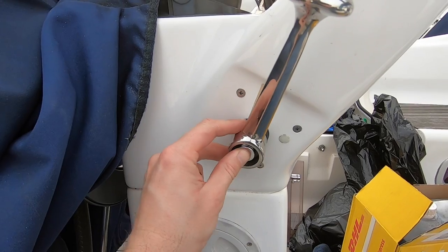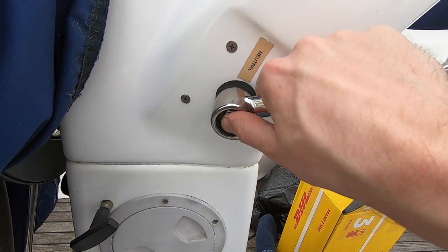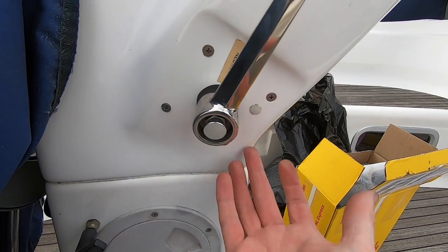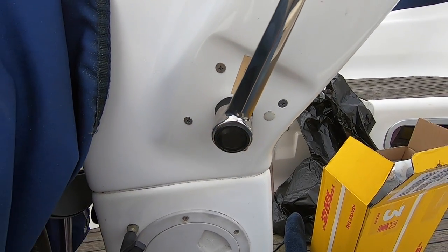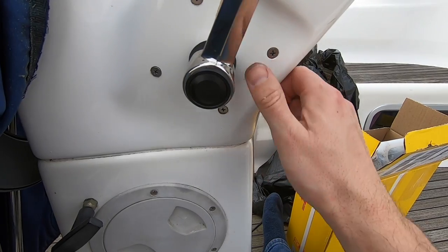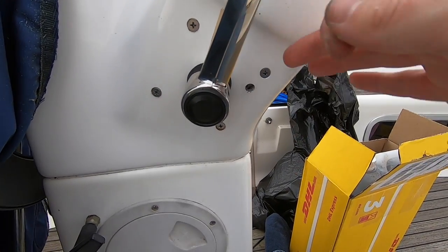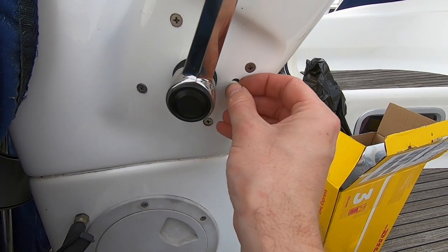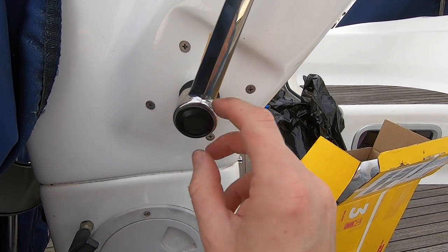This also wasn't working very well, but now that everything's lined back up, when you press that in it's actually popping back out — so it's sitting back in the right place. I've sat and cleaned up the old one and I'm just going to apply the glue and pop that back in — another job off the list. This is the adjuster: behind this little cap here, if you take that off, that's the adjuster. If you need to put more friction on when the lever feels very loose in gear, that's where the adjustment is. You can take this unit out but I don't think it's serviceable. It's now 10 times better than what it was — it was really stiff — and it feels a lot better. I'll glue this in and that's it.